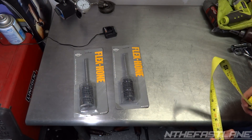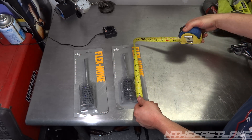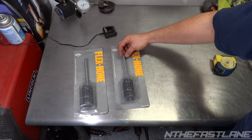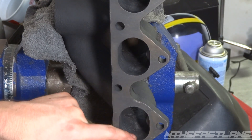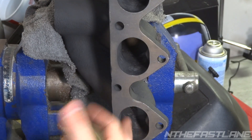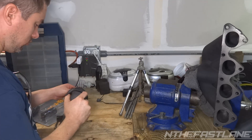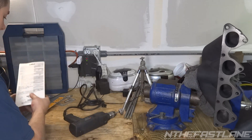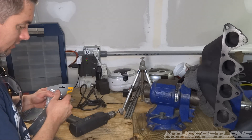As far as length goes, I know that was a big concern — I needed to get it as far down the runner as I could possibly get it. These are eight inches exactly on both of them, so I'm going to measure up the runner. I think we have plenty enough. I'm just going to grip it at the very tip and try not to use as much of that shaft as possible. Here's what we got right now — just a light grind with a little bit of hand sandpaper, it's pretty smooth, but we're going to be able to really smooth this out. It's going to look great and it's going to flow quite a bit better. I'm going to hook this up to a drill and get it as far down the shaft as I can so I got enough space to get it in that runner. Going with the 80 since it's more abrasive — this will pretty much do more porting than polishing.